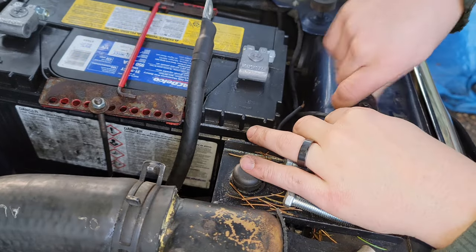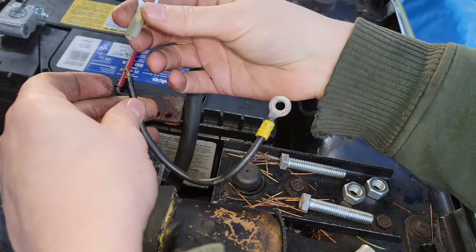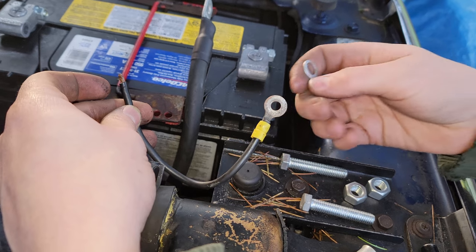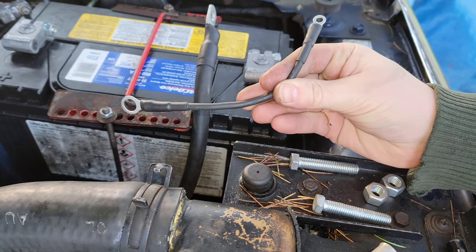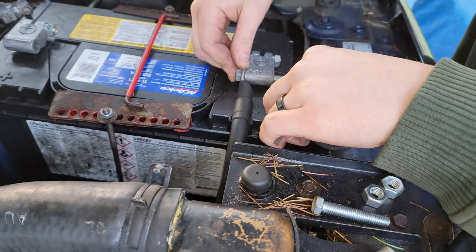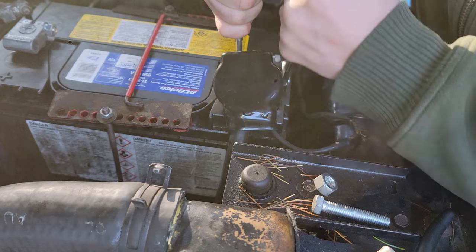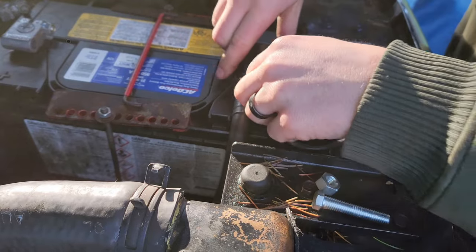Now I'm going to redo my body ground. What I'm going to do with this wire is put marine grade terminals on each end with new heat shrink. This end is going to have a three-eighths diameter ring terminal so it can bolt right to the core support, and this end I'll change so the factory screw can go through there again. I've got my new terminals on with new heat shrink — now we can assemble the whole negative terminal. We've got to put the sheath over first, then slide it on up to cover the negative terminal for a nice clean install.